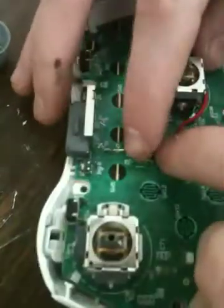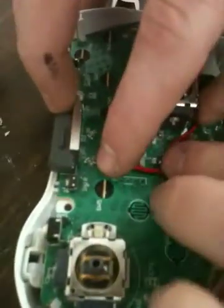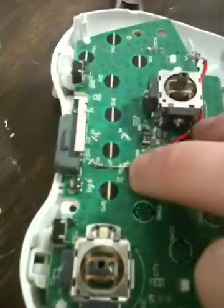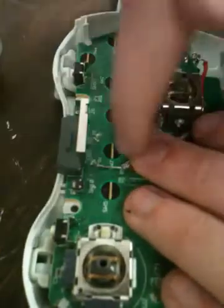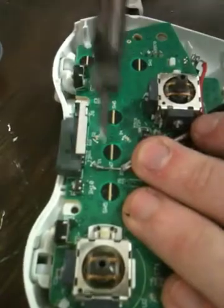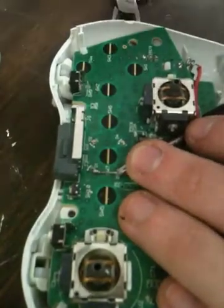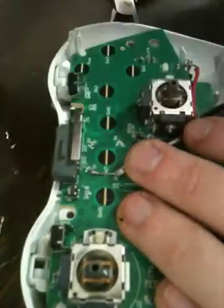And then you're going to touch the top left LED. What you're going to do is you're going to touch the cord right on it. Make sure everything else is settled down here. And I'm going to use this screwdriver to hold it just because the wire gets hot. I already got solder on there a little bit, but what you would do is you have someone help you, and you heat this wire up, and you would have someone hold the solder, and you would solder it together.